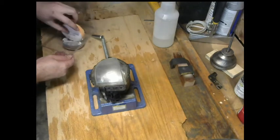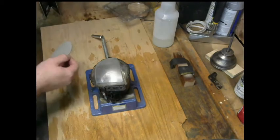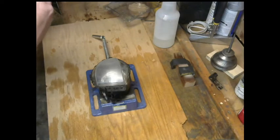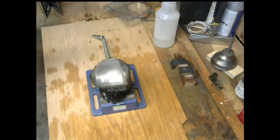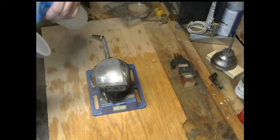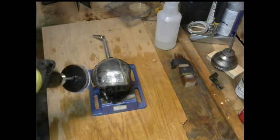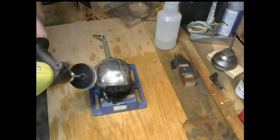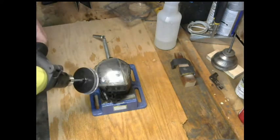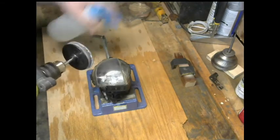Now, next phase, I go to 3000 grit, in this case on a Ryobi drill. This is part of the kit from 3M. And no, they're not sponsoring. Same idea, try and keep away from the edges. Crisscross pattern, and try to have it on a medium setting so it doesn't go away from you and you don't end up burning into things. And you're wet sanding, so keep it wet.